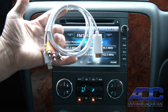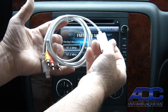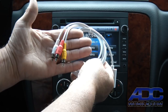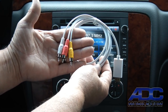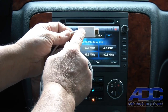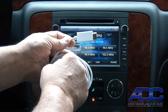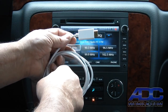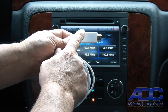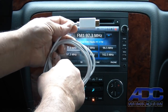This is a demonstration of the HDMI to AV adapter harness that takes an HDMI input on one end and converts it to standard analog audio and video — red, white, and yellow RCAs on the other end. It has an active video converter in the HDMI end, and what differentiates this cable from cheaper adapter harnesses is that this is a true digital-to-analog video converter. It does require power and it does convert HDMI to AV.